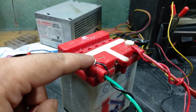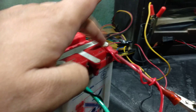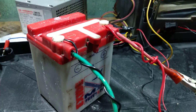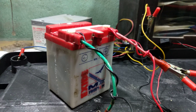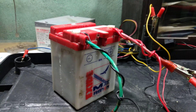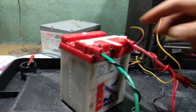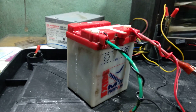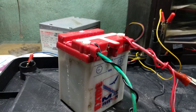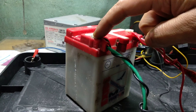At that time I didn't notice that these two points were not clean and properly soldered. I was getting some voltage so I thought the connection was all right, and since it's a seven-year-old dry cell I assumed it just wasn't working. But right now it's giving me voltage, so I will say that Epsom salt and resoldering of these two points solved my problem.